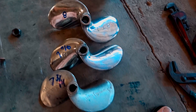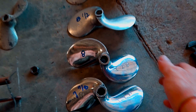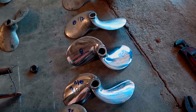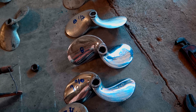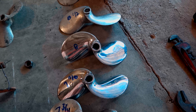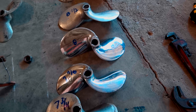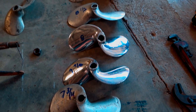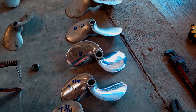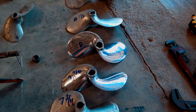You might be in muddy water and want a smaller prop — maybe a 7.75. You want clean water, maybe you want an 8.5. But under most conditions, you're going to find the 8-inch prop works pretty good. The manufacturer would tell you to put an 8-inch prop on it because it's in the middle and works best under most conditions — and I usually have an 8-inch prop on my boat. But certain times I want a smaller or bigger prop. Say I was going up rapids with an 8.5-inch prop and the engine wasn't reaching 3400 RPM — I'd swap to a prop that puts the engine at the correct power curve RPM, and I'd be good to go.